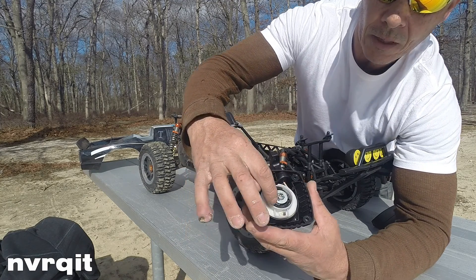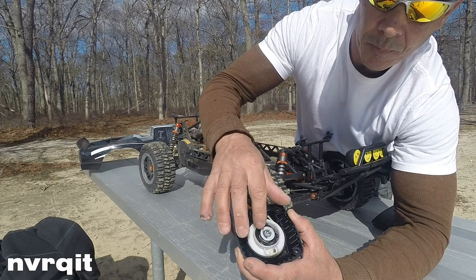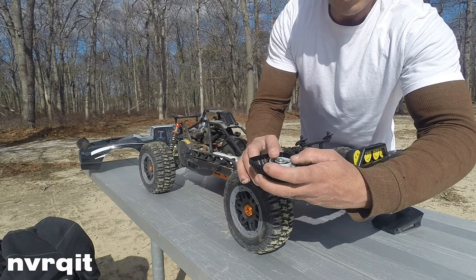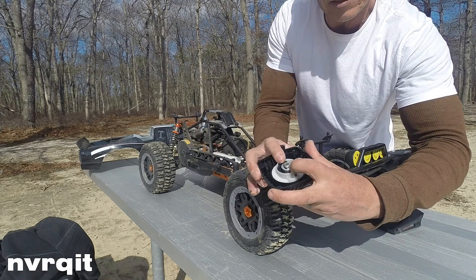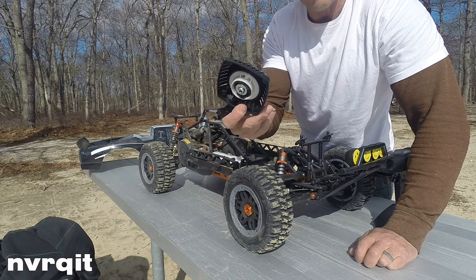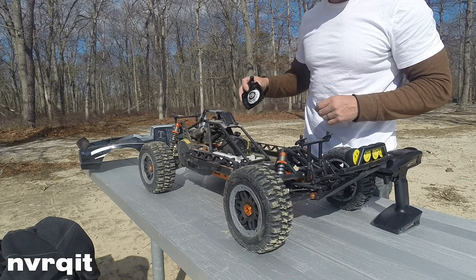What it does: this washer has a little metal piece that stays stationary, and when you pull this around, this spins, and these two tabs push forward and engage with the flywheel. When I built compression on the motor, these broke in half. They sell that pawl for like maybe 6 bucks, or you can buy the entire pull starter for about $14, with an aluminum CNC pawl in it, which I already put in.